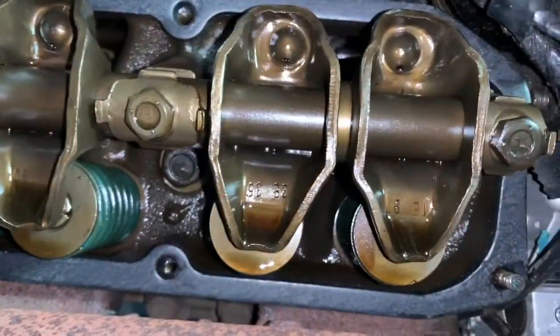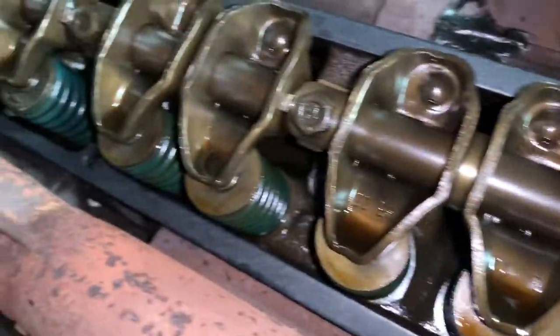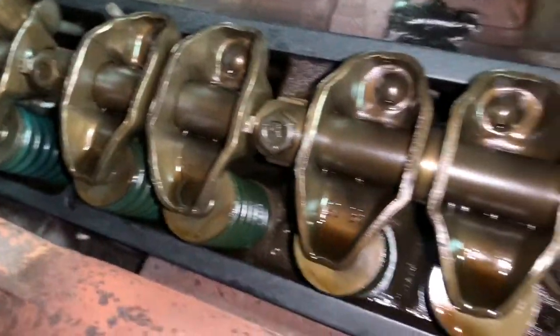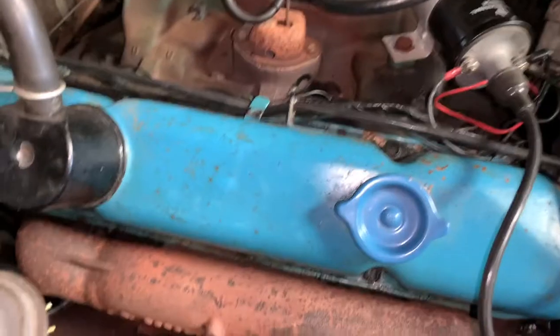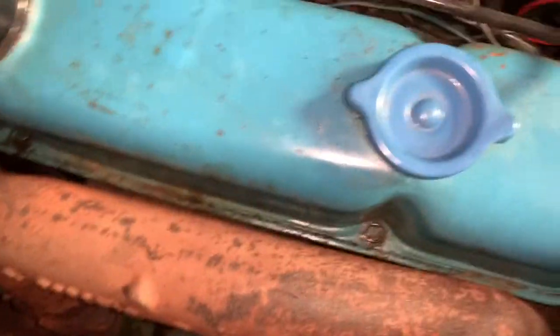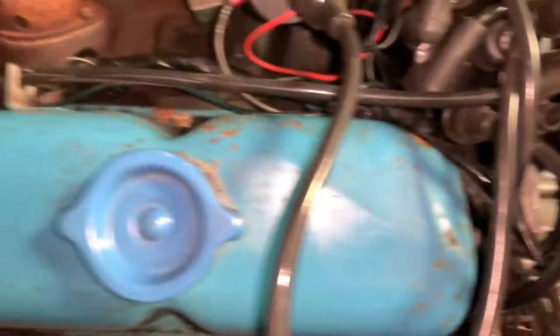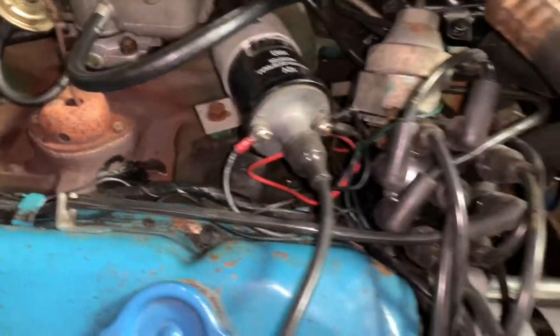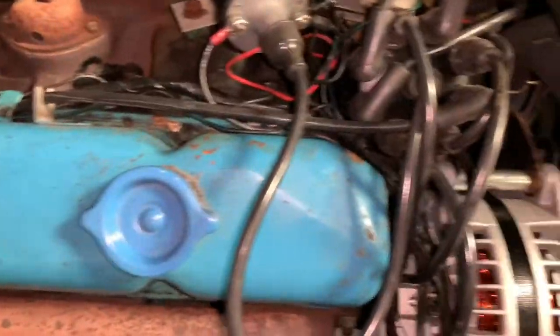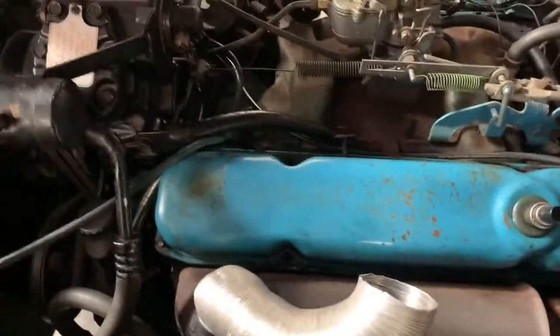See how scuzzy we are. Our old valve cover gasket is gone and the new gasket is sitting pretty, ready to go. Look how clean it is — this car has been taken care of very nicely for its life. Kent will be happy with this. Got our passenger side all done, all resealed and cleaned up. We weren't painting, we weren't degreasing — it's a survivor car, it's gonna stay that way. We were just resealing, gave it a quick spritz with some brake clean, got the heavy goo off, and all the hardware is back on to retain the valve cover.